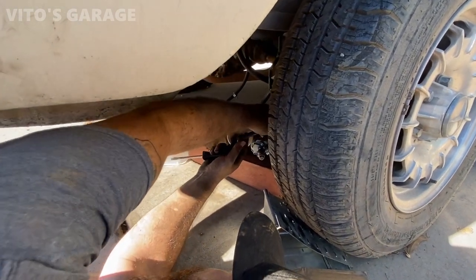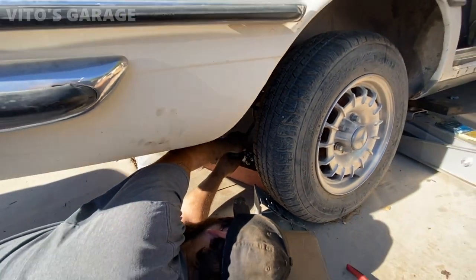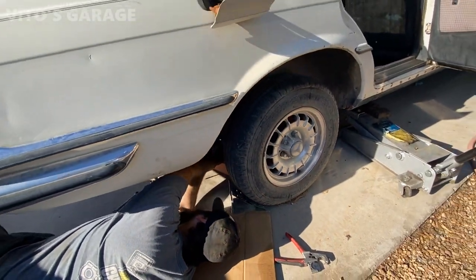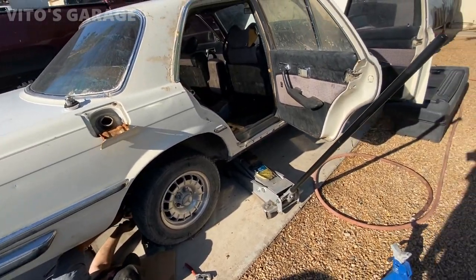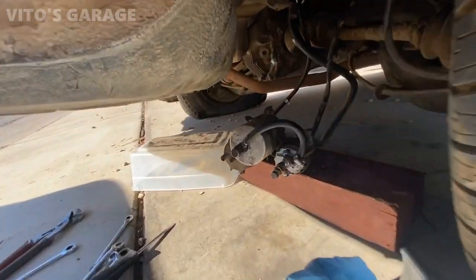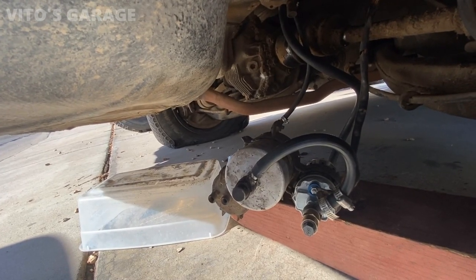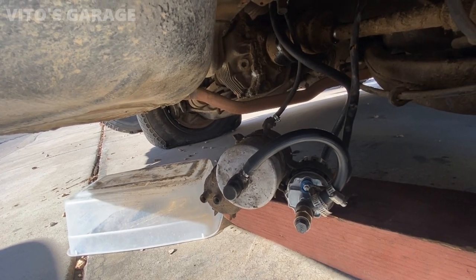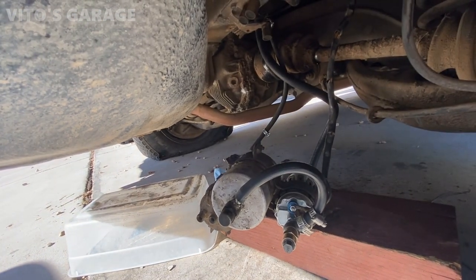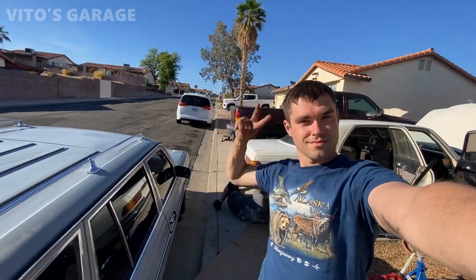And we're gonna retry this test again after he pulls that. So it's gonna be literally just a fuel pump and nothing else. The filter is gonna be out of the way. All right, so I'm gonna take this line, this hose off, and we'll see if there's fuel pressure in there. There probably is. So this fuel filter is clogged. It's not letting fuel through. It's crazy.